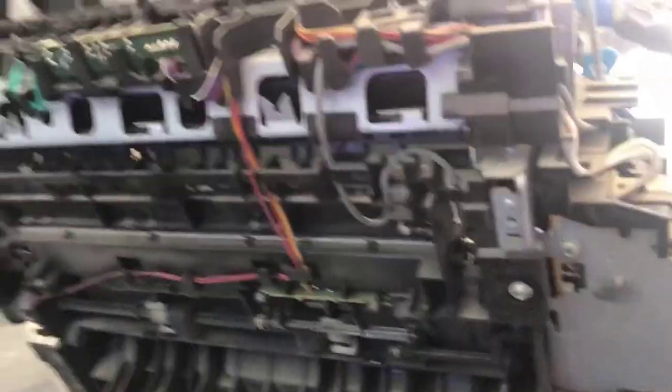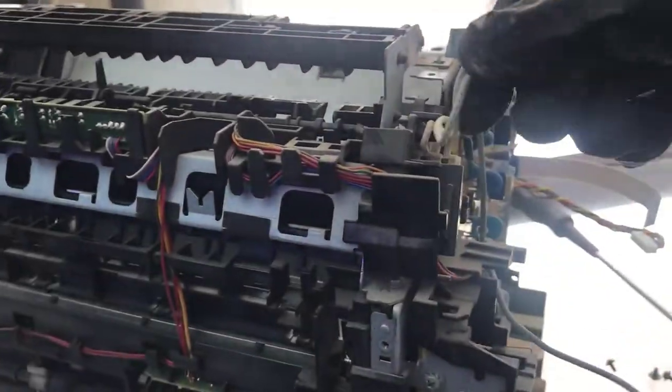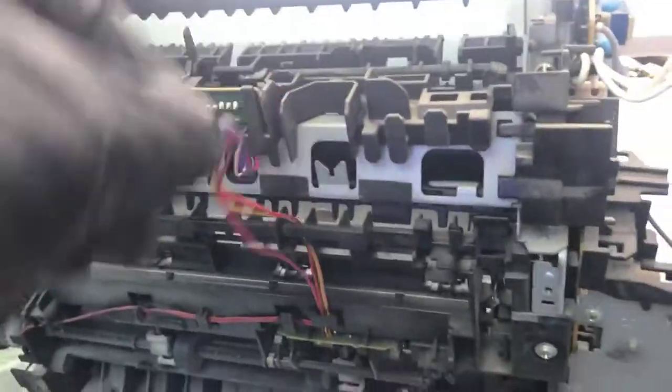Here is the mainboard - the fuser unit's wires are connected here. This is the power cable for the fuser, and this is a DC voltage cable to the sensors. We have to remove this cable. First we will remove these cables, and secondly we will remove these basements for the scanner unit. The fuser is right down these basements. There are two screws here to remove, to disassemble these basements. The cables are removed.